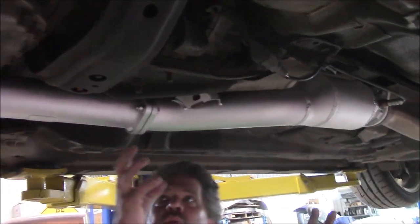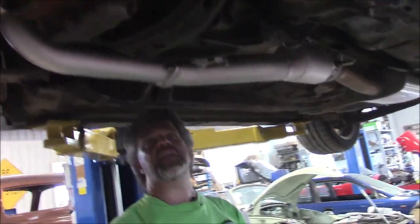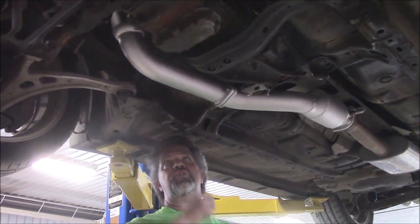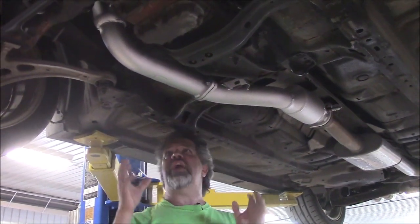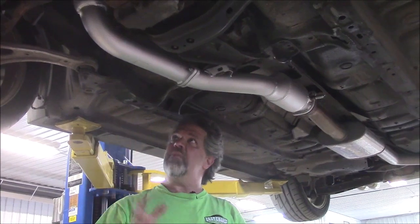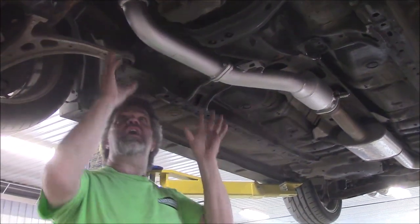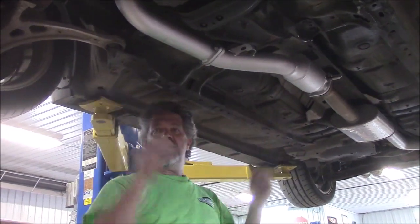We removed all of the old repair gasket material and put the proper gaskets in. Before we did that, we sandblasted these pipes with a special sand grit to get a nice soft profile. Then we applied this extreme high heat ceramic product — rated for 2,000 degrees Fahrenheit — in three coats. Then it was reinstalled and it's ready to go.